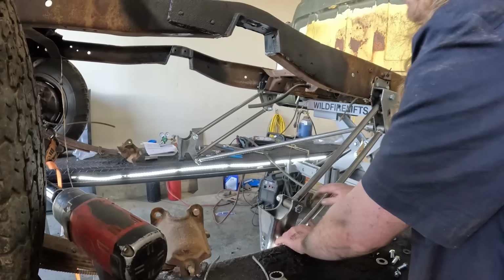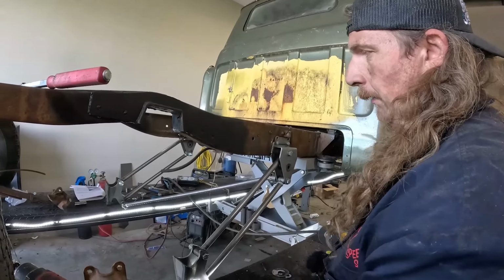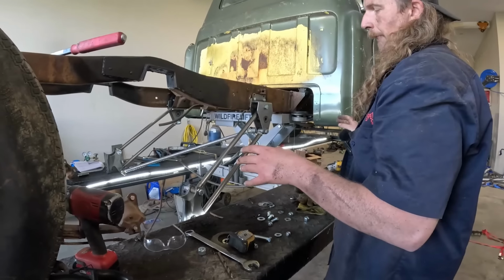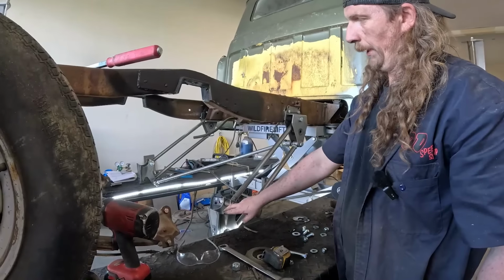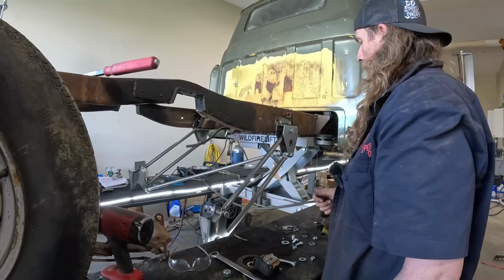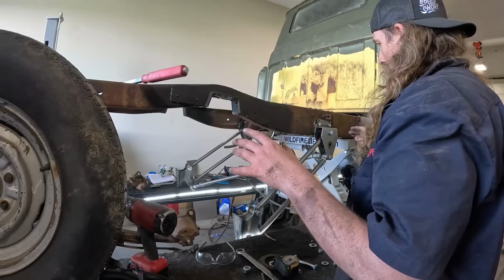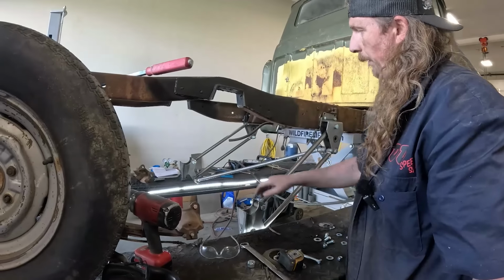Then the last thing we got to do is put the crossmember piece in, hang the coilovers. They'll bolt into the back. So the whole suspension will be together, minus the diff. And then in the next video, all we gotta do is basically undo the coilovers. They'll hang like this, hoist the diff in there, put the coilover back on. And then we'll put some wheels and tires on it and kind of put some weight on it and set the pinion angle, and then we'll just burn it in all the way around.